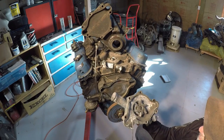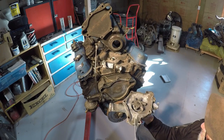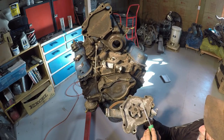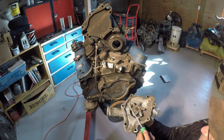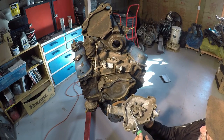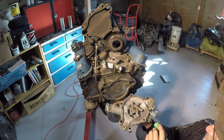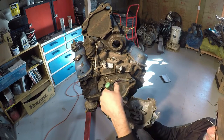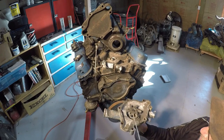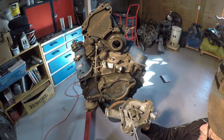The problem is you can't do it with an impeller like this. Now some of them, Chevy's for an example, have a plate that goes across this impeller. And this helps a lot. With a plate across here, it grabs the water and is able to throw it out more easily, and it has to come up over the top of that to come back down in here to just sit there and circulate. So you create a little better volume. And that is something that you can do to improve your flow.